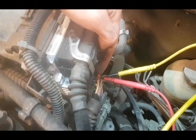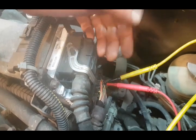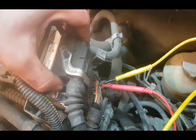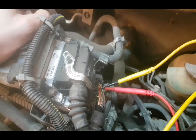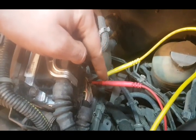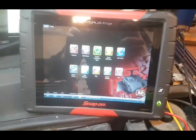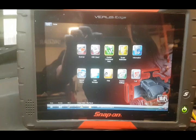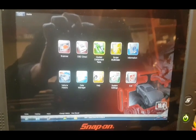What I've done is I have pinned out our ECU. These are the inputs from the throttle pedal. The reason I choose to start at this end is comfort - I find this nice and easy. I prefer it to crawling around underneath the dashboard being very claustrophobic. If we find a fault on the pedal side of things, I'll have to go under the dashboard. So they're pinned out - that's the two channels for the accelerator pedal position sensor. You may also notice I have switched tools. This is only to show people something you may not know this tool can do, which I find a handy function.